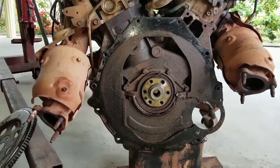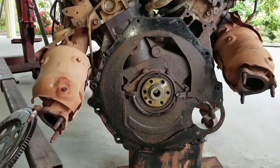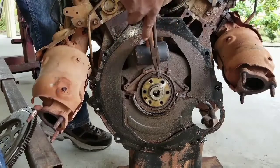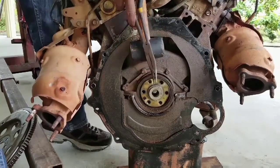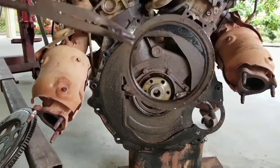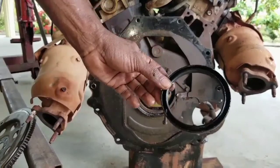We don't want to cause any damage at the bottom on the casting or to the crankshaft. The next step is to take that mallet and, with your needle nose pliers, just pop that seal out. Now you can run your seal to the parts store and get all the specifications required for the replacement seal.